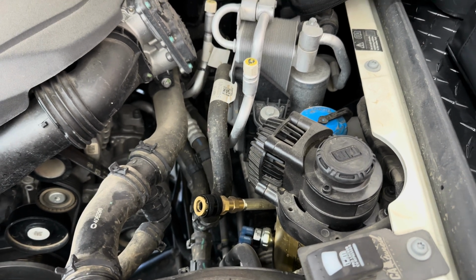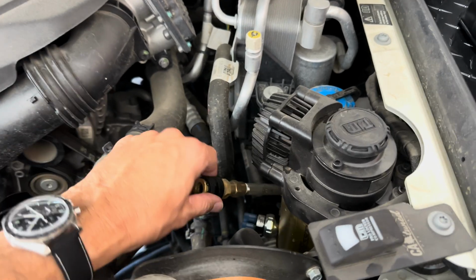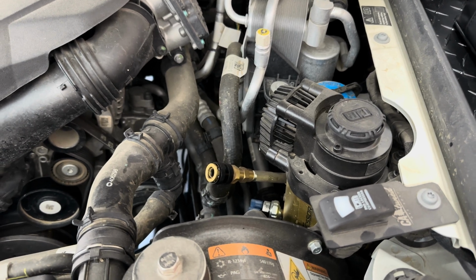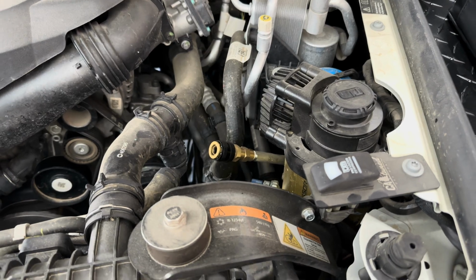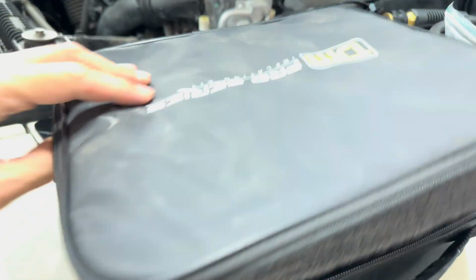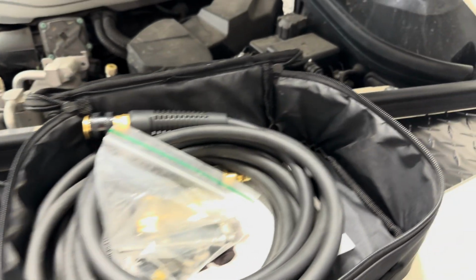But the workaround, I guess, is that when you uncouple the quick connects, the air pressure that remains in there makes it really difficult to uncouple. But all you have to do is, with your inflator or deflator, just deflate, or use the deflate button on there while it's still hooked up, turn this off, and it'll empty the tank, and then you'll have no problem hooking up.